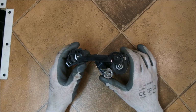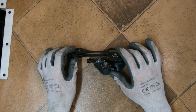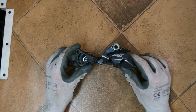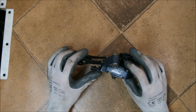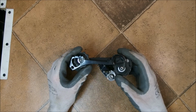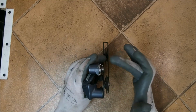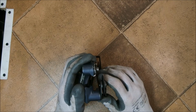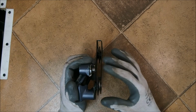This gives these derailleurs 2 very important design features. One, they track the curvature of the cassette very well, and 2, they are rather agnostic when it comes to the size of the cassette they are handling. This derailleur, in spite of being almost 20 years old, I believe, will happily handle a 36 cassette, which was released this year I believe, and they will handle a 25 cassette or possibly even 23, which, if you think about it, is really cool. Moreover, because these 2 springs are working in opposition, and you are tensioning one as you shift and releasing the other, these derailleurs usually provide a rather uniform feel at the lever as you shift.